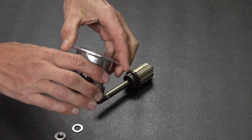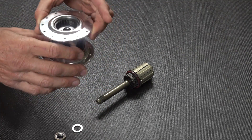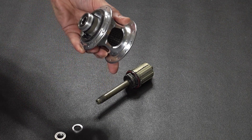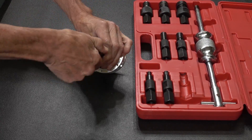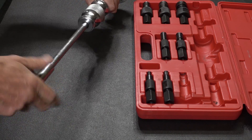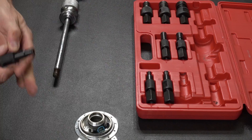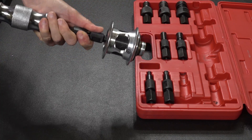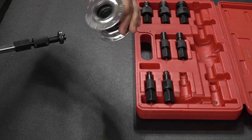There are a couple of little shims and the battery cover has been removed — Shane didn't bring that over, not sure if he had it or not. First thing, let's pull these bearings out using a proper bearing puller so we don't damage the housing or the bearing. There's also a little spacer tube in there which came out, and then we pull the other bearing out.